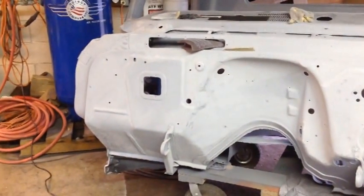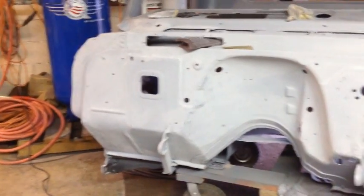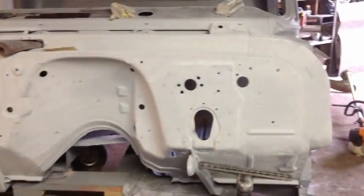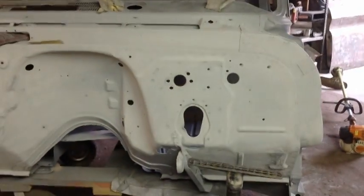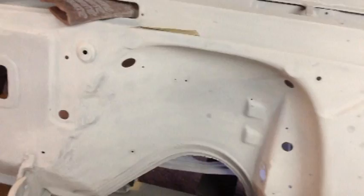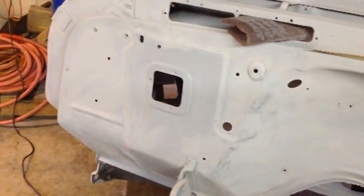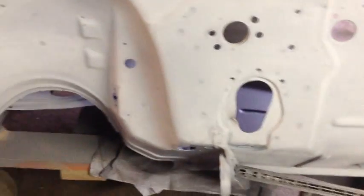Monday and Tuesday — mainly Monday — I had the day off of work. In the afternoon, I spent it block sanding, or really just kind of hand sanding, color sanding this Bondo primer. I can't even talk right — the heat's getting to me. Anyway, been color sanding on this primer here. This is all down to 320 right now, and it's actually pretty dang smooth as it is.